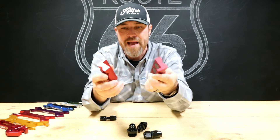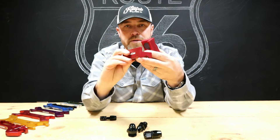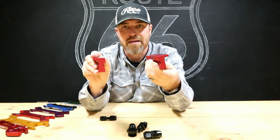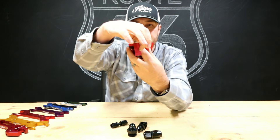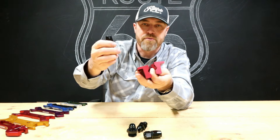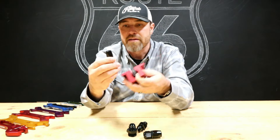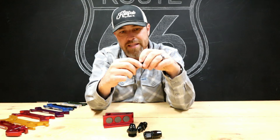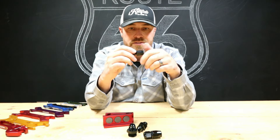That's where this comes in — these are magnetic vise jaws. They've got magnets on the backside and they're also made of aluminum. You basically stick these in your vise just like that. They're grooved so the fittings will fit in either horizontally or vertically. You put the fitting in vertically and that helps you get the threaded piece started, then grab your wrench and tighten it all the way down. This little piece has barbs inside that hold onto the line — as you screw it in, it expands and really grabs the line, which is why these are so great.